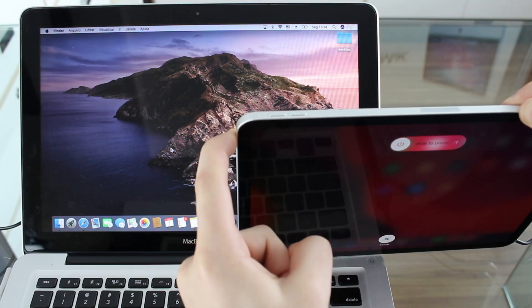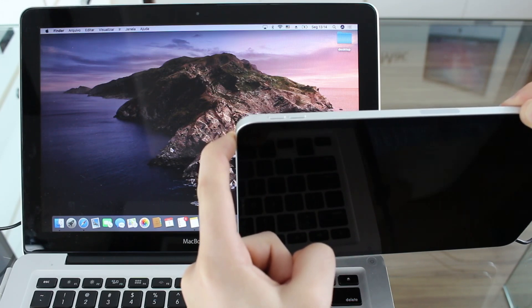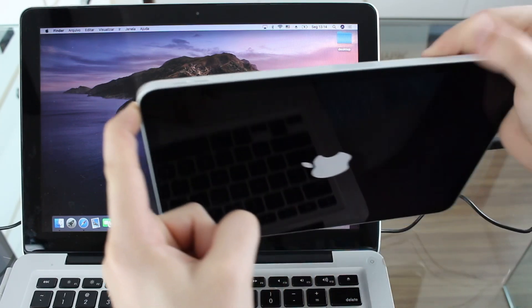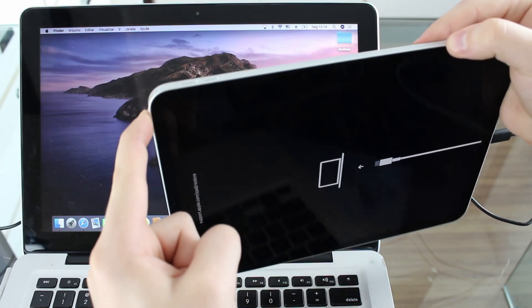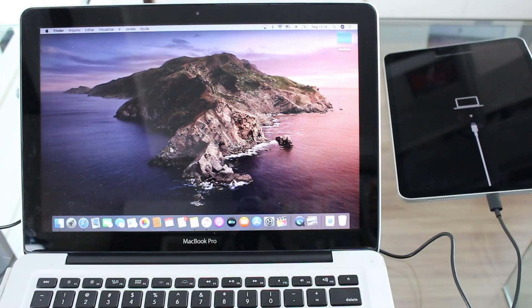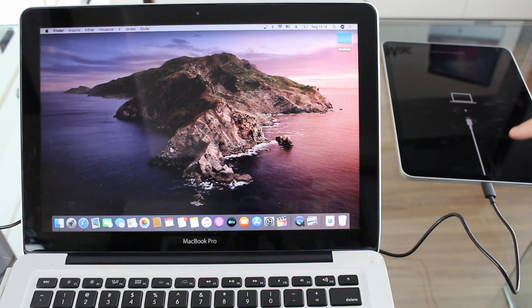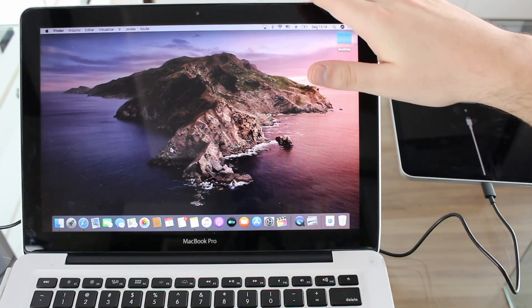As you guys can see, you have to be a little bit fast — you can't go too slow, otherwise it will go into Siri mode. So volume up release, volume down release, and press and hold the power button. I'm not pressing and holding any other buttons, just the power button. And just like that, you see the recovery mode screen. All you have to do is release the power button. Now you can put your iPad on a table or desk because we're not going to touch it anymore. Never unplug the cable — always leave the cable plugged in, and don't touch the iPad. Everything we need right now we're going to do from our computer.